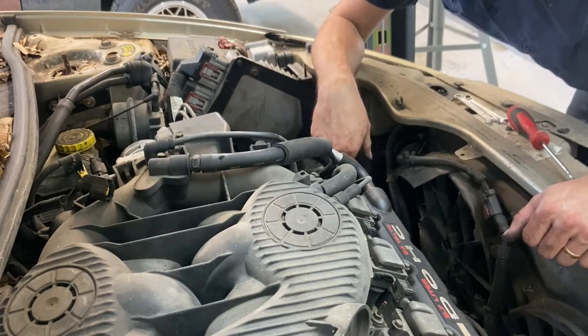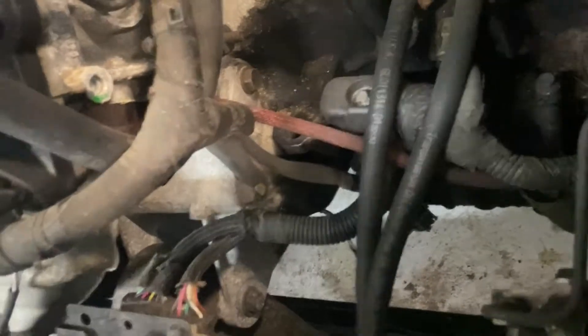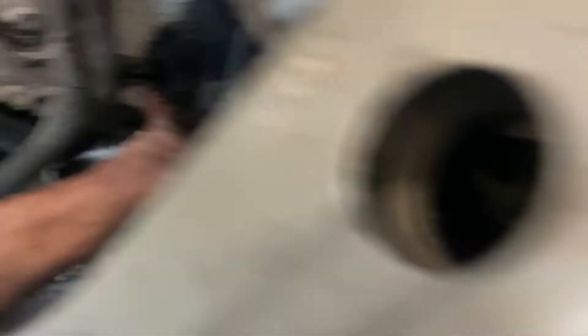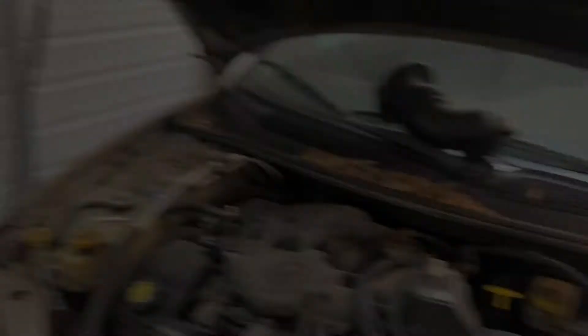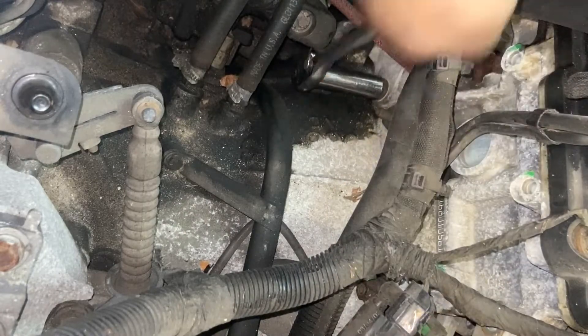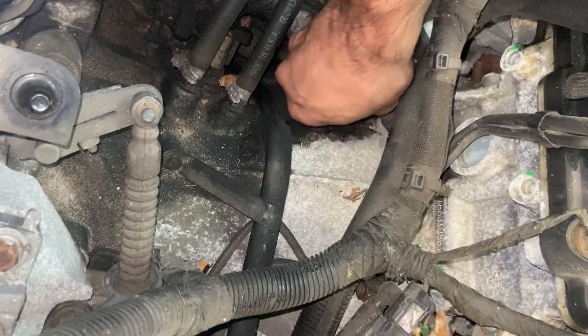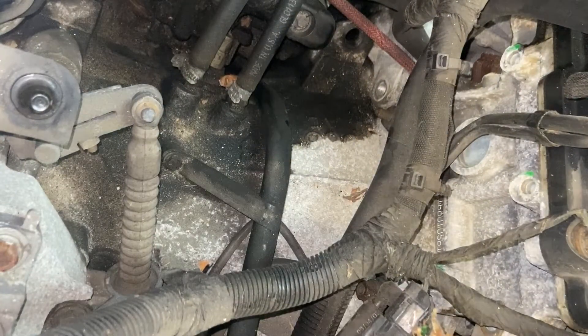The air box is out — simple and easy. As you can see, that's that one bolt I've got to get out. There's two at the bottom holding this on, so I'm gonna go ahead and pull this top bolt out while we're up here, and then we'll get underneath, support the engine from the bottom with the jack stand, take out the bottom two bolts and the one bolt holding it to the mount on the chassis. And then we should be able to get to the starter — if there's enough room to get the mount actually out of the way, we'll see. That wasn't even tight.